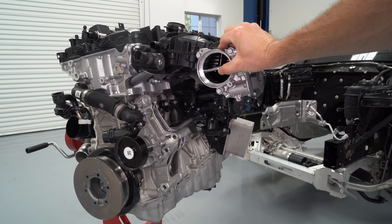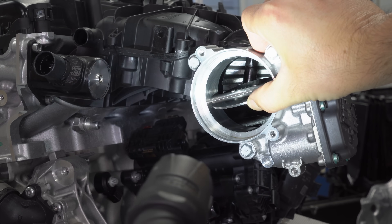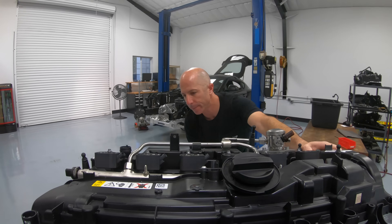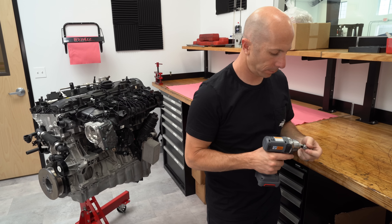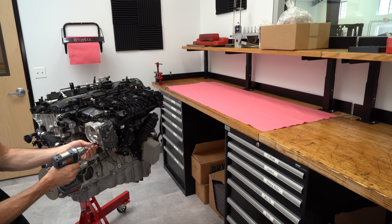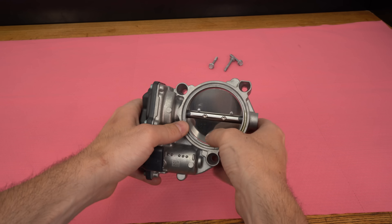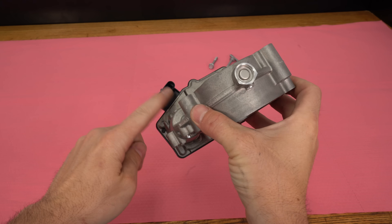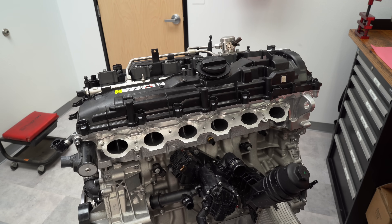Here's the drive-by-wire throttle body, and inside is where the intercooler is — it's actually a water-to-air heat exchanger. The intercooler cools the compressed air back down before it enters the engine, making it more dense and producing more power. Modern cars don't use a throttle cable anymore; it's all electronic, and the speed of the electronics is actually faster than your foot can move. If you're unhappy with how your drive-by-wire responds, it's really a tune issue — it's not inherently a problem with drive-by-wire.